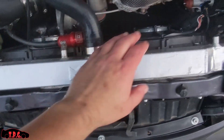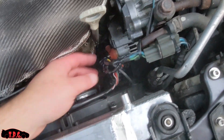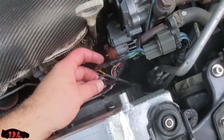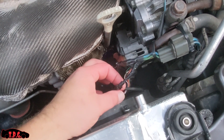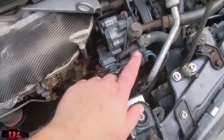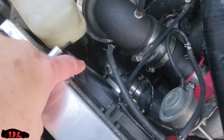There are two slim fans here, and what I did was wire them into the stock wire harness right here with the stock plug. This is ugly right now because I just had to pull it apart. They just keep popping this fuse, and I thought maybe there was a wire that was bad, or maybe something rubbed the insulation off with bare wire grounding out someplace - but that wasn't the case. There's a stock plug here and also another stock plug way down there under the coolant overflow jug.